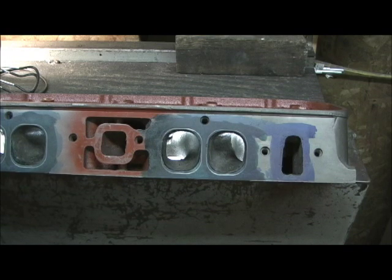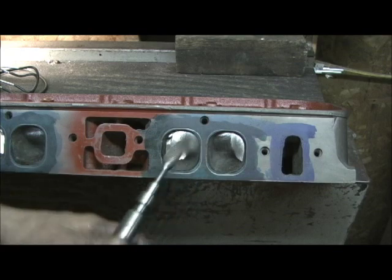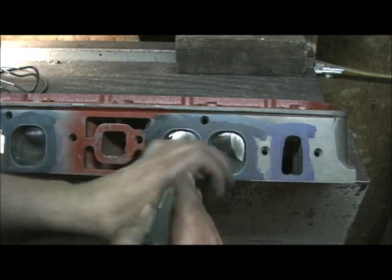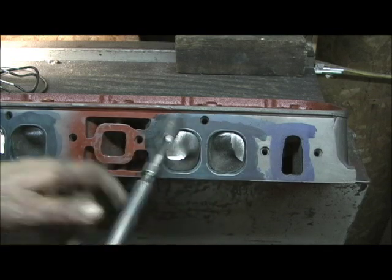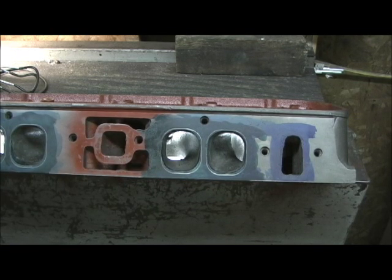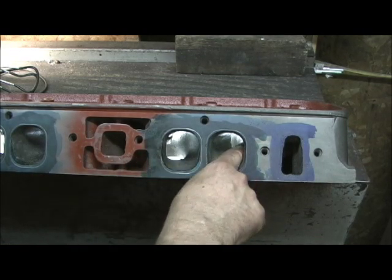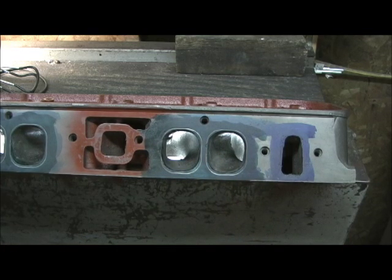I'm going to go ahead and begin some of my trenching. We're still using this tool because there's so much fillet radius to turn it into a baby rectangle. I'll be starting here and pulling it out, actually trenching with this, then raw material removal. I'll be spending quite a few hours straightening this hole up. We also have a big obstacle on two of the ports — this port right here and then the other one over there — with a big lump I've got to straighten out to try to balance the runners.